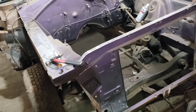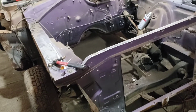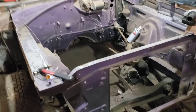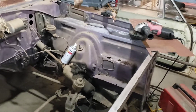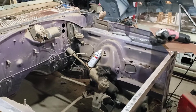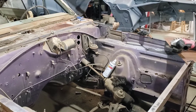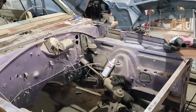As I mentioned in previous videos, I'm going to wait and blast the engine bay and engine compartment and all that stuff. Right after that, I need to do that rust repair under the battery tray. After that, I can then prime it, then base coat, clear coat, and it'll be white, just like the rest of the car will be.